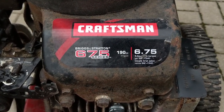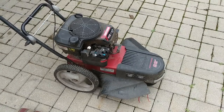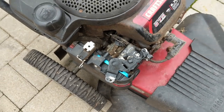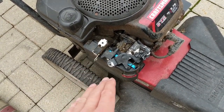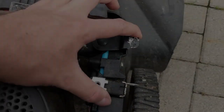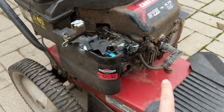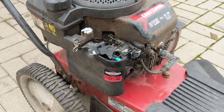I'm going to check the spec to confirm this engine should be at around 3,200 RPM. If you want to find the idle speed for your particular engine, go to Google and type in — for example — 'Briggs & Stratton 675 series idle speed.' The Briggs & Stratton manual says to set this engine to 1,750 RPM on low idle. I prefer to set them on high RPM because on low RPM they tend to flutter and surge a little bit. They run better at high RPM, giving a more stable reading. For this engine I set the high RPM to approximately 3,200 RPM.